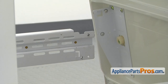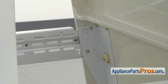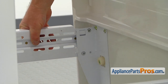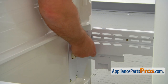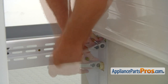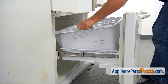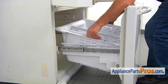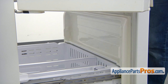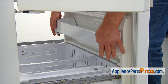We're going to hang the freezer door onto these rails and slowly place it in. The two hooks on the top lock into the cutouts, and then we're going to lock these sides and secure it with the 10-millimeter bolts. Now we're going to install the freezer basket in — slide it forward, lower it down, this end goes in, and place it down. Now we're going to install the adjustable shelf: both end brackets go in, and press it down.